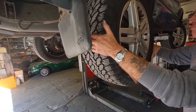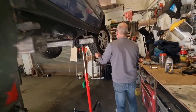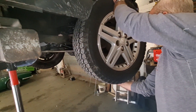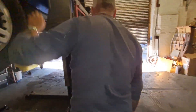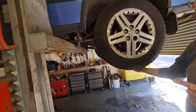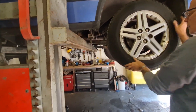There's nothing in that one. Is the handbrake on? Yeah, it spins alright - nothing in that one. Get to the front. You'll have to do top and bottom or else it'll move on the steering. Nah, it's just a bit of tyre movement. All good - looks like our wheel bearings might be good. We've got no ABS lights on. What have we got on? We've got hill descent and air suspension. The only thing we've got on is the ICE. Yeah, they're all good.